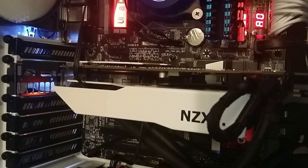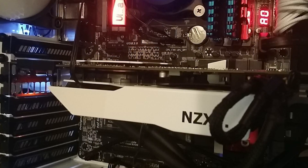You also want to make sure you have enough space, because big modern gaming graphics cards can sometimes overlap another PCI or PCIe slot, making that one useless. So I would try to go a little higher if you could — say if you might use up to five slots, try to get a motherboard with six or even eight, to make sure you have enough room for everything to fit.